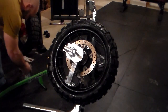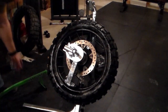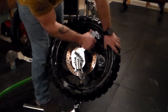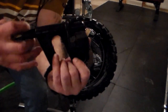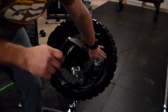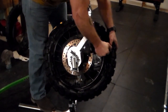We're going to repeat that procedure for the other side of the tire now. Go ahead and put your bead grease on this side. Now we're going to be using the drop center tools — they're not necessary for every tire, but they're definitely necessary on this BMW. We're going to position our duck head at twelve o'clock and use the same process as before. Get the tire behind the duck head, and now with these drop center tools, you see this handle pulls out and opens up that channel. We're going to lock this onto the rim and use it to push the rubber down to keep it at the drop center of the wheel. If you don't have these tools, you can use blocks of wood, and without them, the tire is just going to keep popping up on one side as you're trying to put it in.